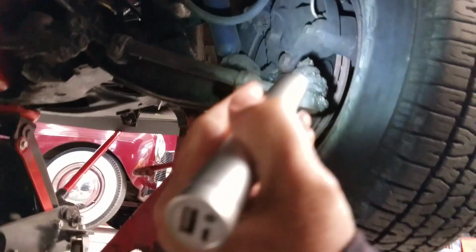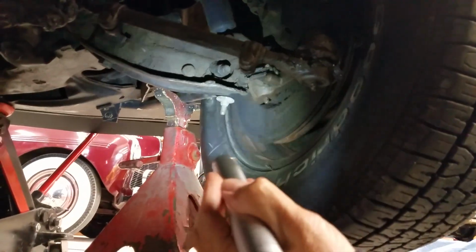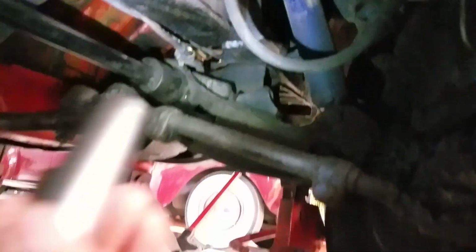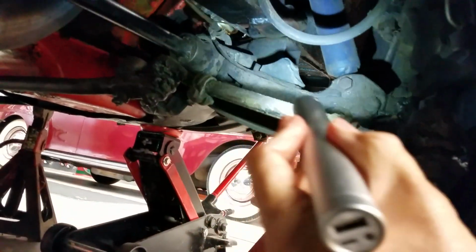Before I move though, here's our upgraded factory disc brake package. Control arms are all in good original shape. Back sides of the fenders look good. Insides of the fender wells look nice. Upper rails don't have any crush or compression in them. Didn't see any sections or repairs in these rails before the A-frame, or the K-frame rather.